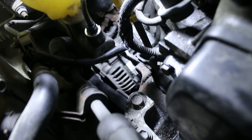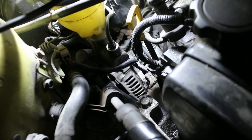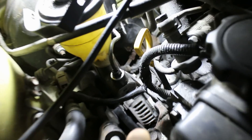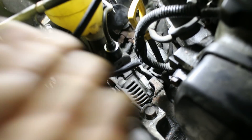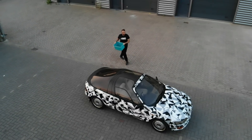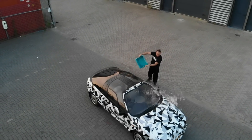The first thing I did was actually really boring — it was the alternator, which you can see hidden right underneath here. If you remember the pickup video, I was stranded on the highway because the alternator only charged up to 12.02 volts. That meant I could start the car and drive it, but turning on the headlights would leave me with a dead battery on the highway, which is really dangerous. So I took the entire alternator out and brought it to a specialty store that rebuilds alternators, since finding a Toyota Sera alternator is nearly impossible. They rebuilt it for about $150.